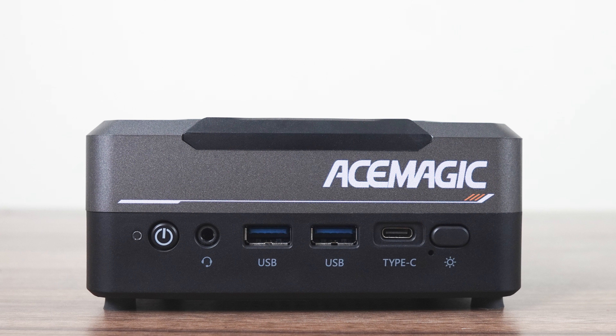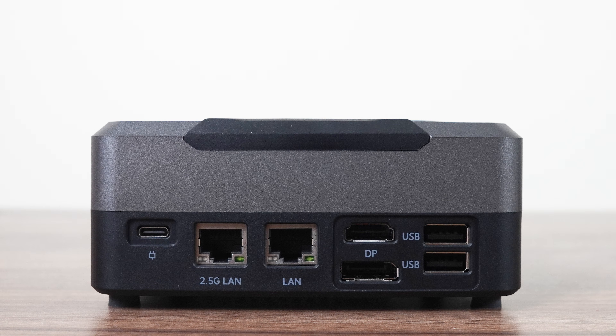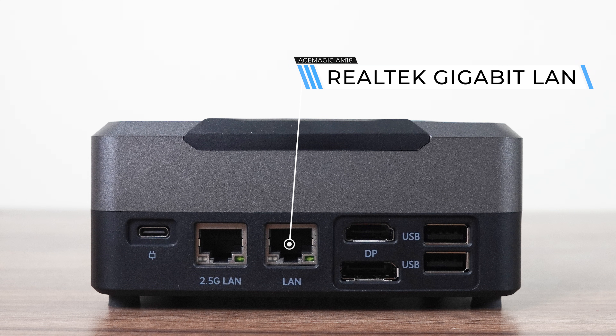On the front there's a lighting control button, two USB 3.0 10Gbps ports, and a USB 4.0. I was able to briefly power on the mini with my USB-C monitor through the USB 4.0 port, but it shuts off after a couple of seconds — likely because my monitor only provides 75W maximum. The back uses a USB-C port for power, and while my monitor was again able to power it, it doesn't provide display through the rear port, so it's not much better than a barrel jack. There's also a mix of Intel 2.5GbE and Realtek Gigabit LAN, HDMI, DisplayPort, and dual USB 2. You can run three displays natively on this one.